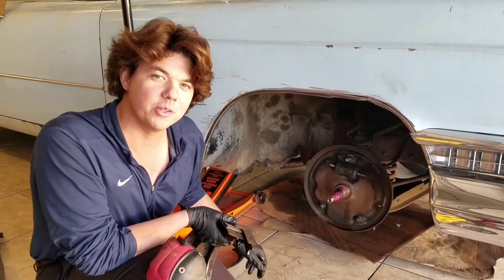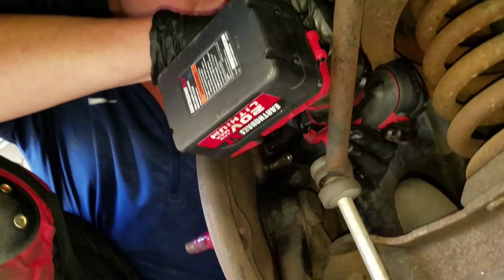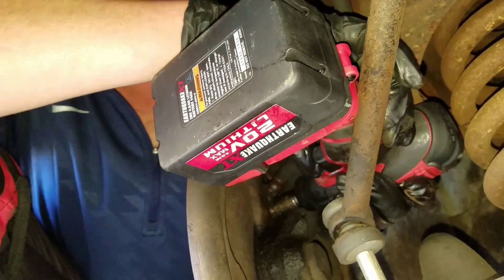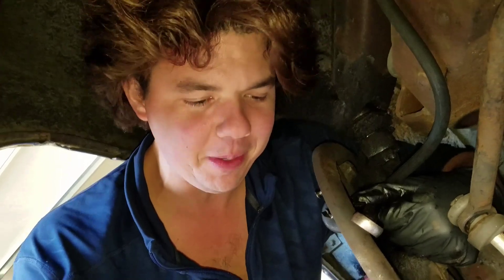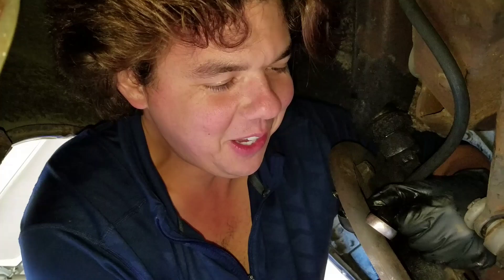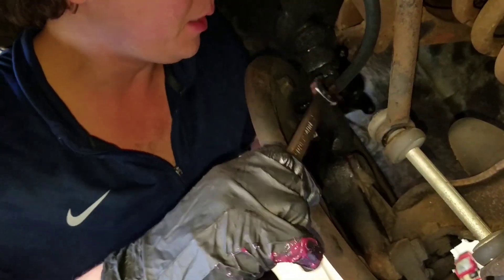So let's go ahead and get this wheel cylinder off. Got the impact wrench in here — it's a 9/16ths. Let's go ahead and take off that wheel cylinder. There we go — she's done, 5/8ths. And now all we do is just tap it. I jumped the gun a little bit and I actually took off the wheel cylinder first — you've got to take the line off first. Sometimes in life you just got to wait a little. There she is. She's loose.